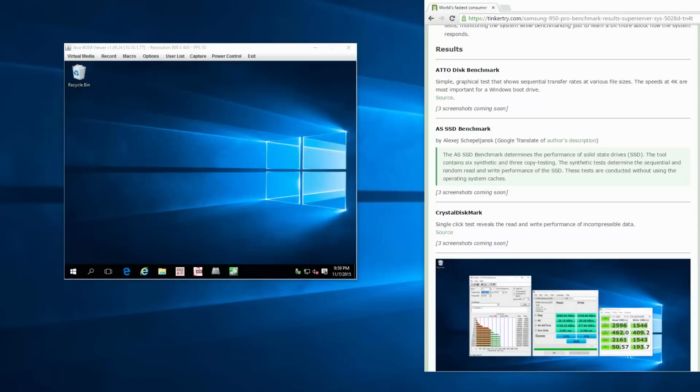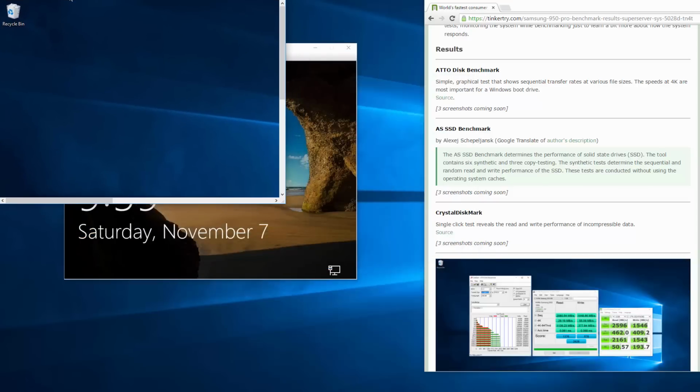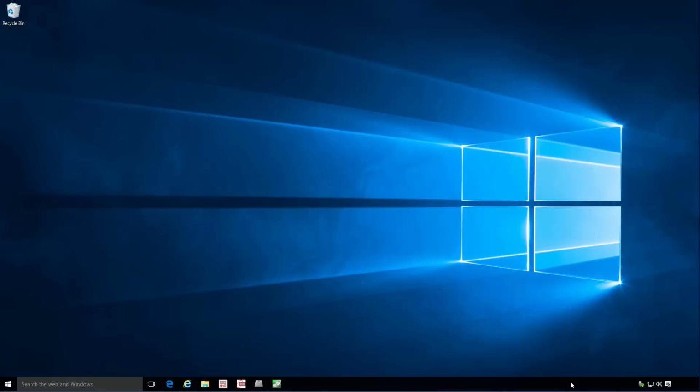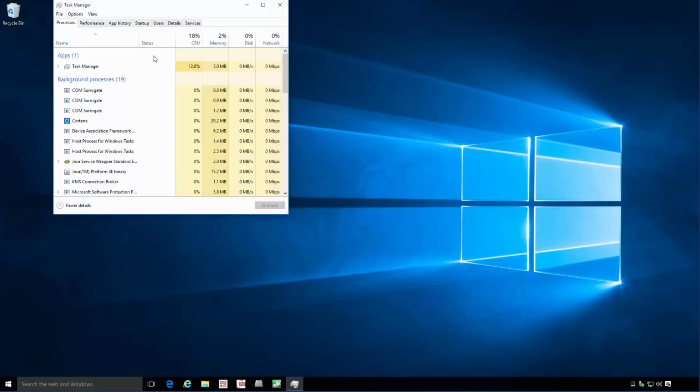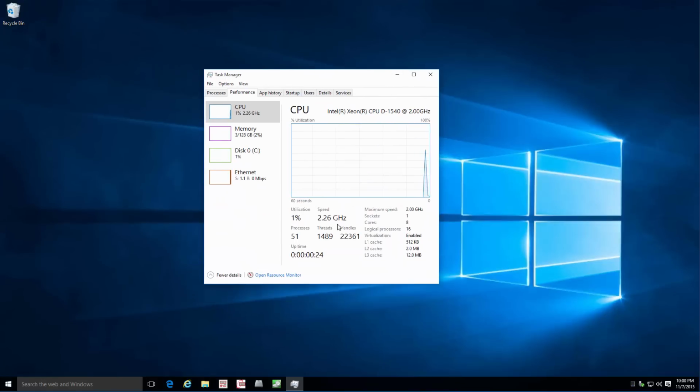Okay, now we're booted. I'll give you a nice clean full screen now. And what I wanted to show you is the effect of what we just did. What we just did was told the CPU to not go into its 0.78 gigahertz mode when idle. So here we have a machine that's doing nothing, 0% CPU, and the gigahertz is always kind of high. That means you're burning more watts. So yeah, good for benchmarking, not so great for operating the machine.